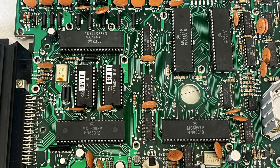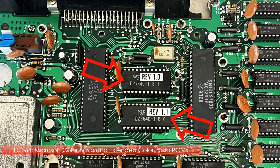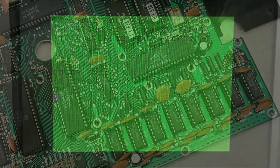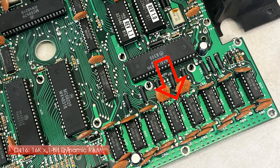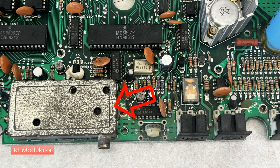First off we've found the 8-bit processor running at 2 MHz, followed by the video display generator, the synchronous address multiplexer, the peripheral interface adapters, the base and extended Microsoft ColorBasic ROMs — which we can check using an exec command — 16K RAM and the RF or radio frequency modulator.